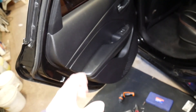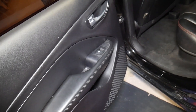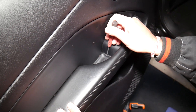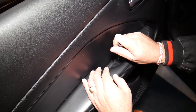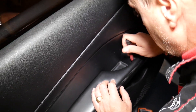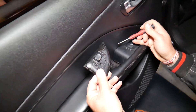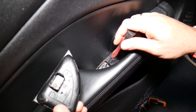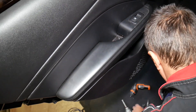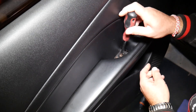We need to remove a few covers on the door panel because we have hidden screws and bolts. What we're doing on the left side will be exactly the same for the right side as well. We need to remove that cover — just grab it and pull it out. Why? Because we have a hidden bolt or screw there requiring a 7mm socket. If you need to buy any tools, check out the link in the description of the video below.